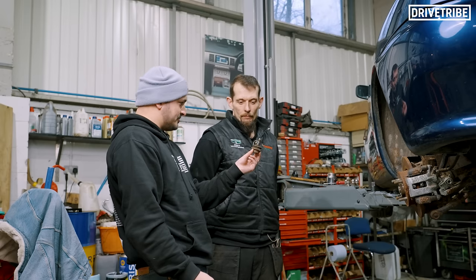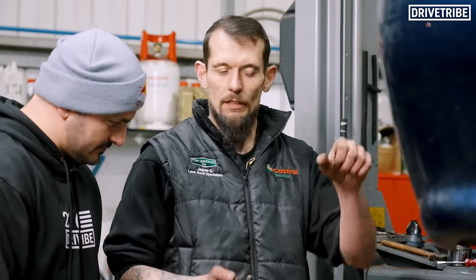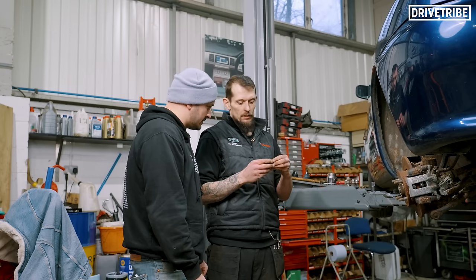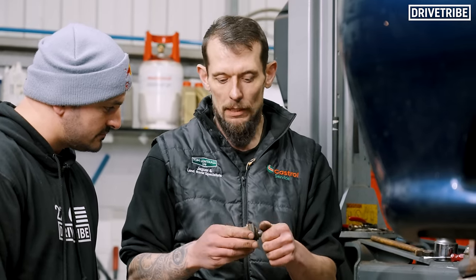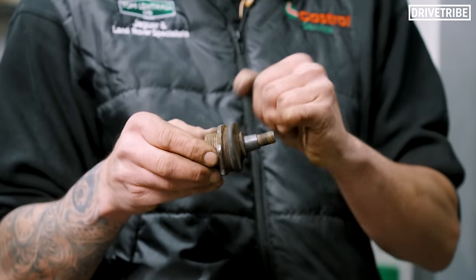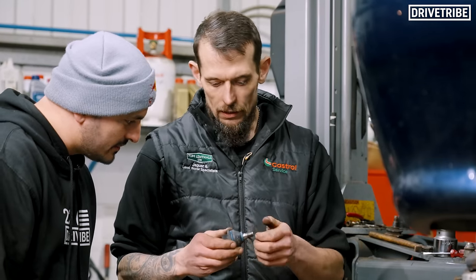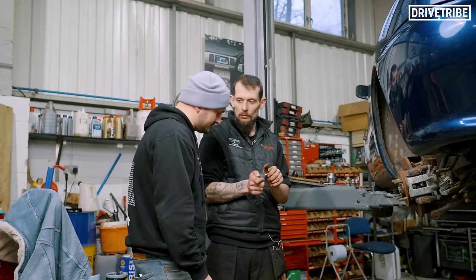So what are you looking at with this ball joint that says it's not good? When you've got the wheel on there and I'm going up and down, I can feel play in this ball joint. I got the apprentice to move it up and down as well, put my hand onto it and I could feel it. The only thing I can notice whilst it's in my hand is the fact that I can move that ball joint with my pinky. Compared to the brand new one - I can't move it with my finger. It's nice and solid; it takes a bit of force to move, which is how it should be.